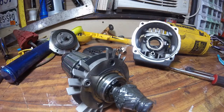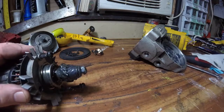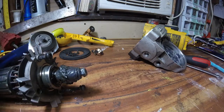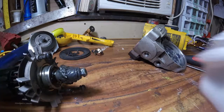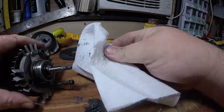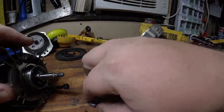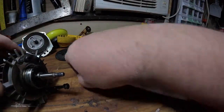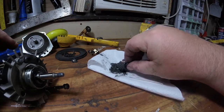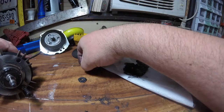And then this spinning gear — I'm going to clean that off, remove the cap nut and everything. It sits on a sort of a keyway. It's not pressure fit like some other tools. I'm going to clean this off — it slides right off. You see it appears to be the same size bearing. I'm going to take a measurement here. You can see the end of the motor has a heat sink, possibly magnesium, as well as a fan for cooling. So the tool seems to be engineered to handle the kind of abuse you're going to give to it.